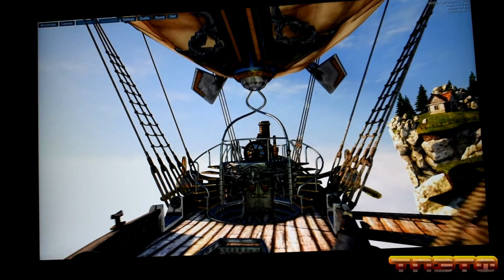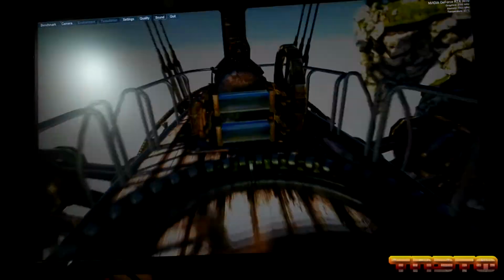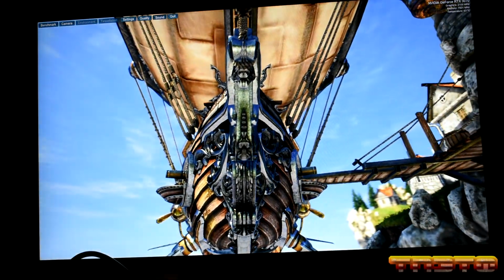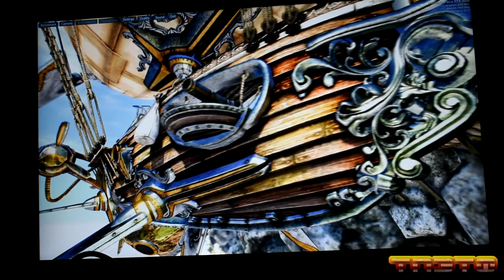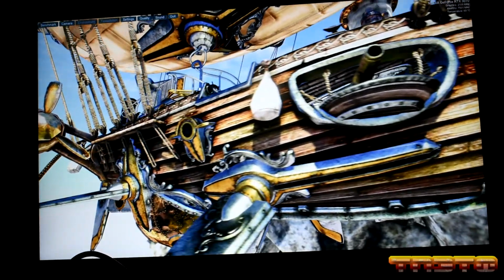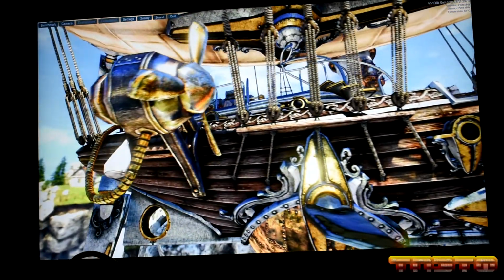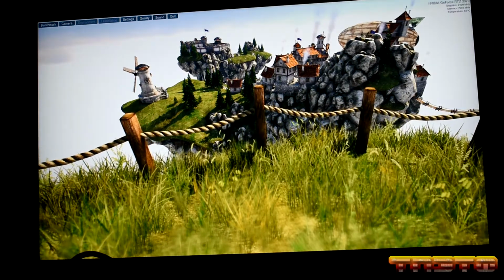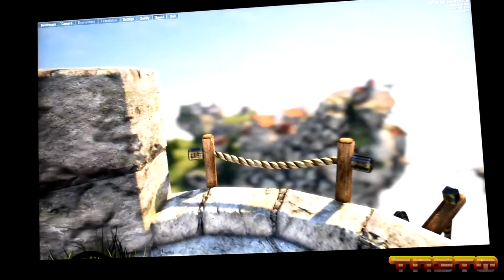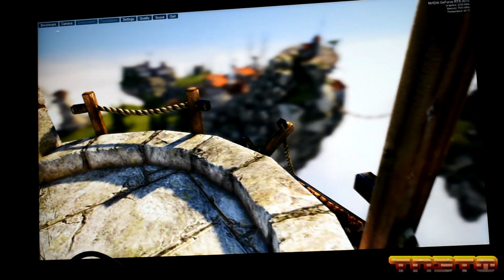Our audio is working because the monitor has a built-in speaker, so NVIDIA is spitting out an HDMI audio signal there. I'm going to look at the GPU right now. The benchmark's not running. It's just doing the preview thing right now. But I'm going to look at the GPU, and yes, all 3 fans are on. Yep, all 3 fans are spinning now. They're not spinning very fast, more like a medium to low. I noticed the 3rd fan looks a little wobbly, maybe it's just the way the sticker is, but just the center of it. But I don't hear any bearing noise or anything. So the fans are okay. They're all operating. So we'll go ahead and click the benchmark.